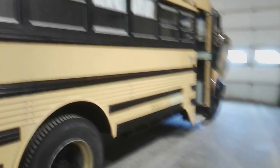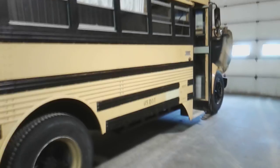A lot of people ask how they're going to lock their bus. I see people using house locks and padlocks and all kinds of stuff. This particular bus has this handle here that is supposed to lock the door. If you shut the door regularly and just give it a push, the door will open back up. But if I slam the door, it will not open. The only way it will open is if I pull this release handle.